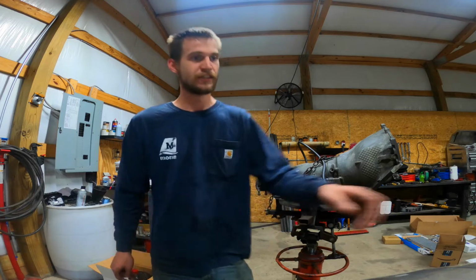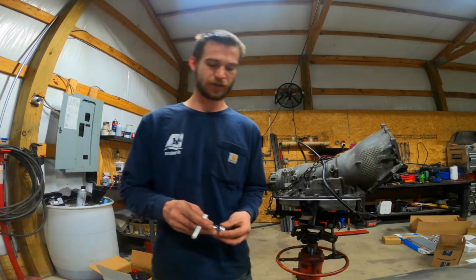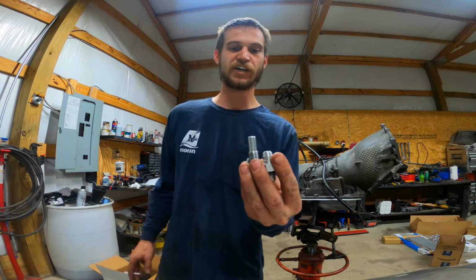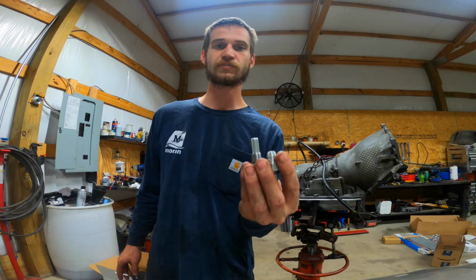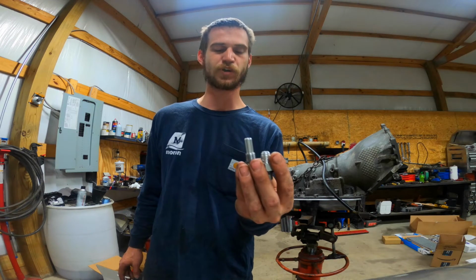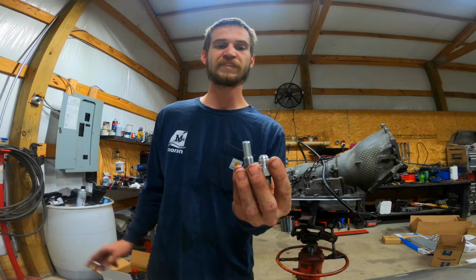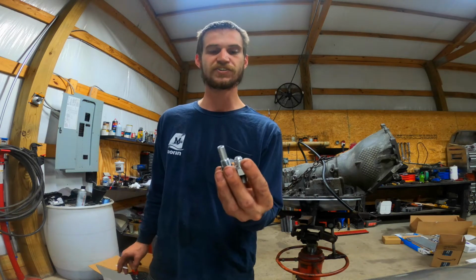So to start off, I'm going to slap these fittings in here. The early model transmissions don't have this extended neck on it, so you're going to have to get the ones for the early model. I'll link both. The early model 4L80s, I think they came in the square body Chevrolets, don't have this extended neck, so I'll link those in the description if you have the early 4L80. These are for the late 4L80. If you do not have this extended neck, you're going to run into issues.